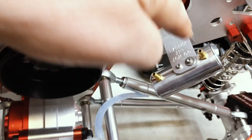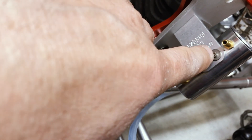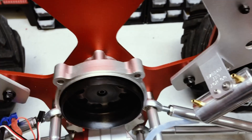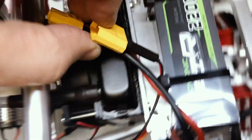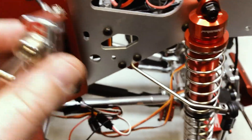Then you're going to mount your water storage tank utilizing a bolt that's already in the frame — just take that nut off. This already comes mounted on a bracket. Do not remove those screws; it's sealed, pressure tested, and mounted to the plate already, so you don't want to remove this. All you're going to do is remove that one bolt from the frame, put this on, and tighten that bolt back up — put it at about a one o'clock position. Then I mounted the radiator with the cooling fan — that all comes pre-assembled. Use the two mounting holes already on that brace and the two included screws; it just screws right down. To make clearance for that, I removed the battery kill switch that was normally mounted on the side — you don't need it anymore if you're running electrics, but save it in case you ever want to go back to gas.